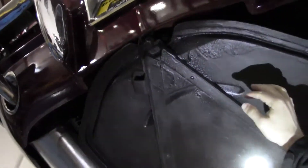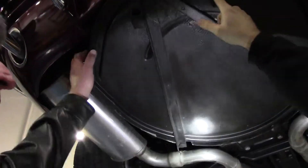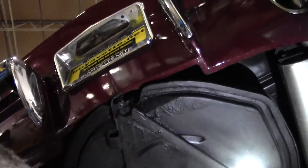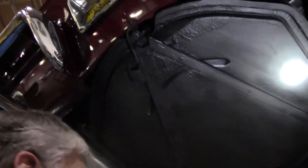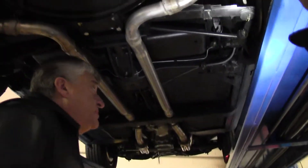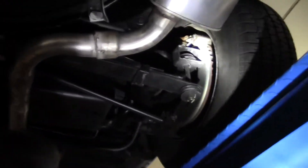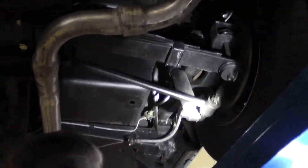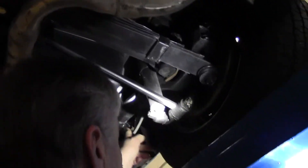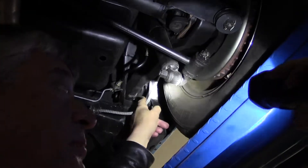Greg, I know that you know an awful lot about the underside of these cars. I do want to point out we do have the tub and spare tire for this car. The spare tire feels like it's brand new. With that, we can also say it's immediately obvious that it's got all new exhaust system. It's had recent work on the brakes and calipers, new brake lines all the way back, e-brake cable appears to be in nice condition, trailing arms in excellent condition. The bushings you can see up here — this is recently redone, which is very important.